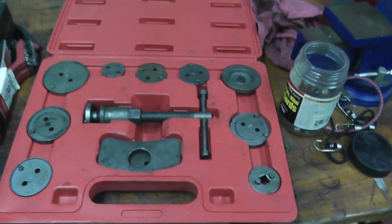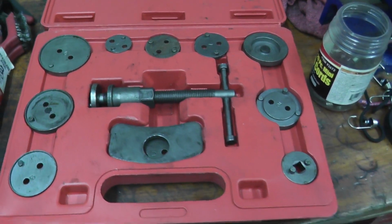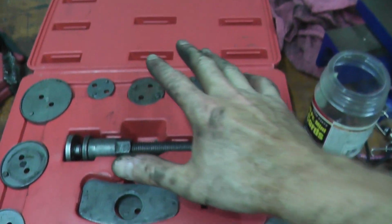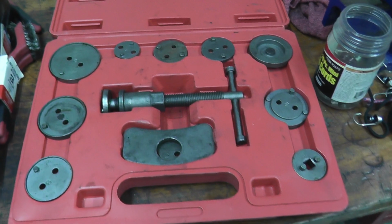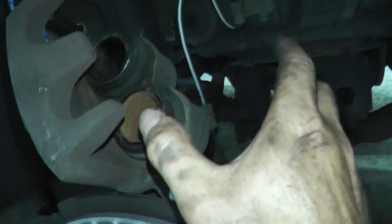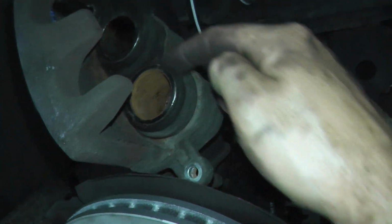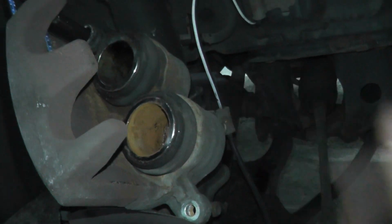Now this is a very inexpensive brake kit. You'll see why I'm going to use this. The flip side, and I'll include a playlist in the description box below, I typically show just using a C-clamp and a block of wood. But again, because I just want to wrap this up and I have this here, I'm going to use this tool. So what this tool does, or if you're using a C-clamp with a block of wood, you want to press the pistons back into the bore of the caliper.